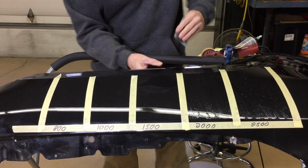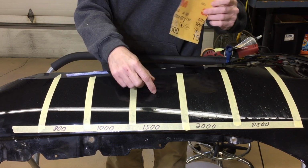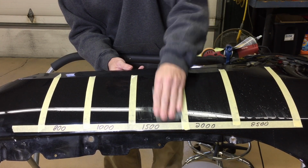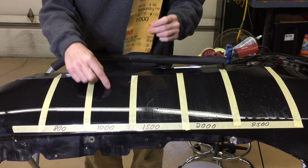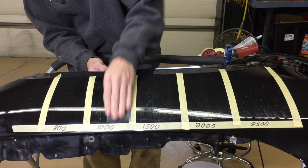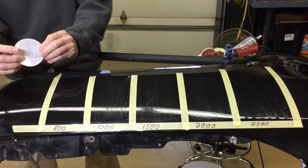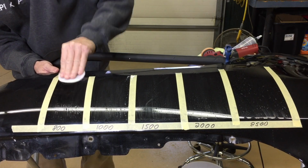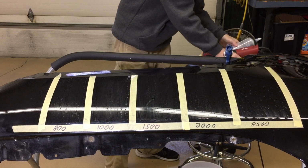So just a quick overview for those just tuning in or new subscribers. For the test here, we section off five little areas where we're going to put different grit sand marks in each section, starting with 2500, working our way all the way down to 800 grit. Now, the 800 grit section, a lot of compounds aren't designed to remove such damage, but a lot of them tail off in the 1000 grit section, and it's really fun to see how far these compounds get. We also look and see if the compounds dust. Is the residue easy to wipe off the panel after it's spent? And we look and see after we wipe off the residue, how good, how deep, how quick the compound has cut.